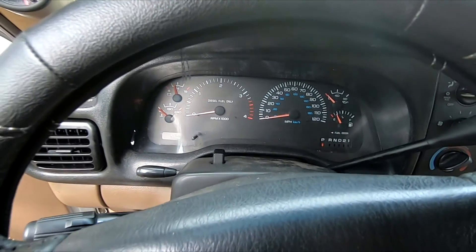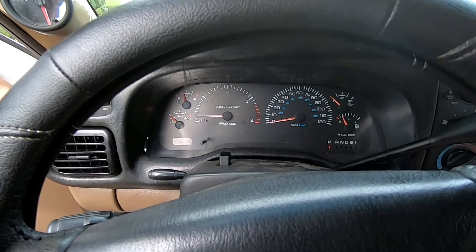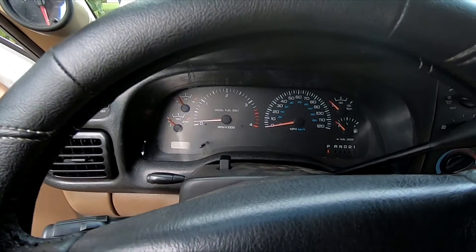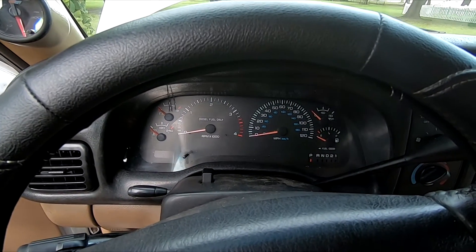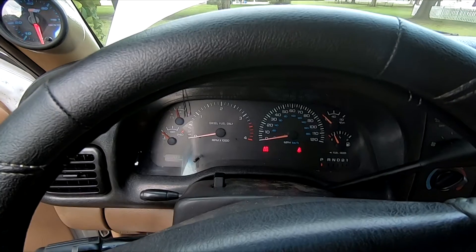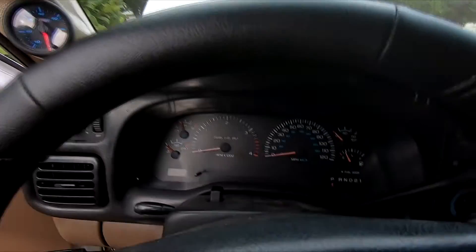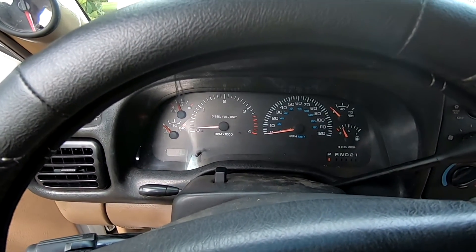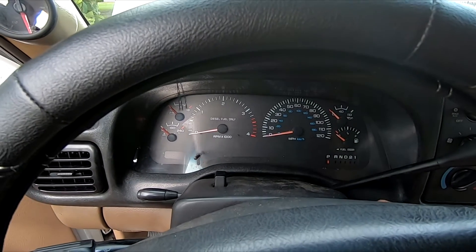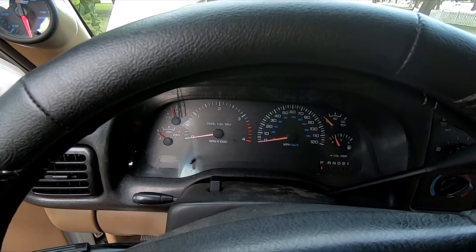Obviously this first start is not going to be a direct representation — we're going to have to let it run for a while, make sure there's no more air bubbles, and then see what happens. She's trying but I let the system bleed out so there's air in there. I also adjusted my fuel pressure so I have closer to 17 psi now, which should help in terms of running. Hopefully this one does the trick — I'm going to let it run and take it for a spin to make sure I've got all the air out.